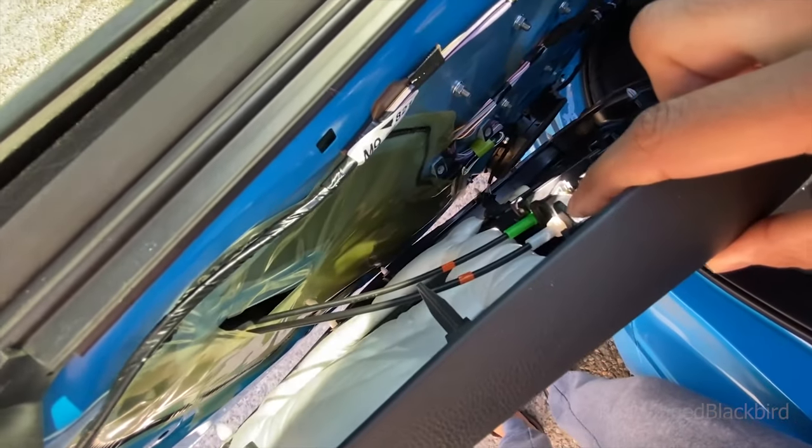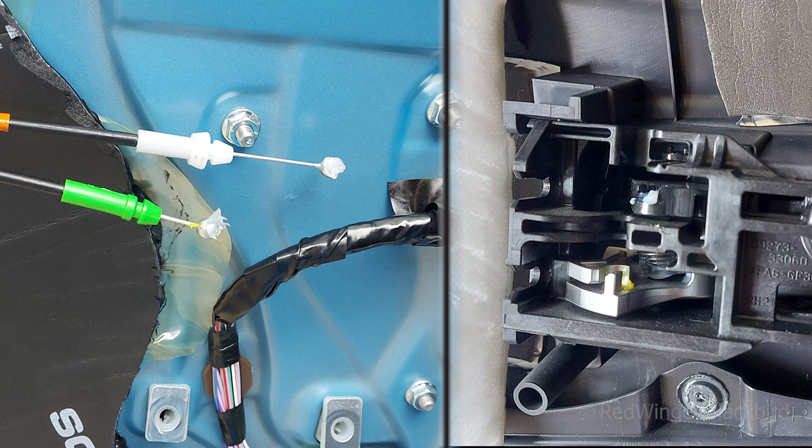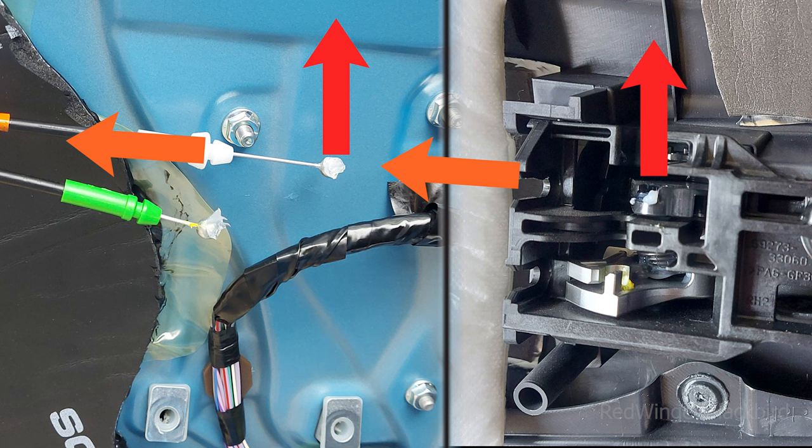When you open the door panel, you'll see two cables for the door lock and door opening mechanisms. Pull up on the small ball clips on each cable first for clearance, then pull the clipped pieces completely out from the door to fully disconnect the door panel. Also, any white plastic clips that stayed on the metal door should be moved back to the plastic door skin for easier reinstallation — use pry tools to pop them over.